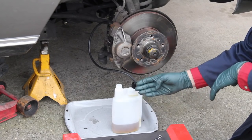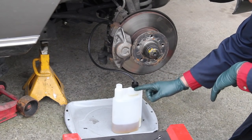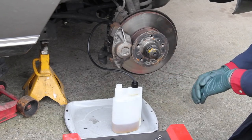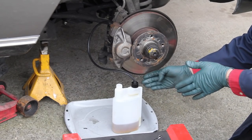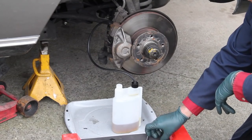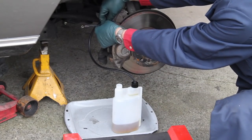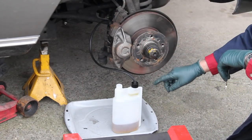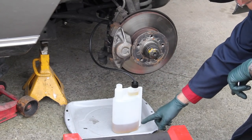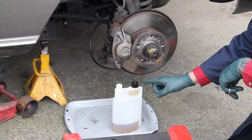Now look at this bottle. This is called my twin chamber brake fluid capture bottle. It has a very small pre-chamber right here, and out of the top of that pre-chamber you'll see this pipe tube that comes down and goes into the bottom of the bottle. This is one liter in size. I've already begun the bleeding process to save time in this video, and you can see I've got quite a bit of dirtier fluid down here in the bottle. I always remove this cap here to keep from pressurizing the capture bottle when bleeding, and I open this up about a half a turn. You can see the fluid coming in the little pre-chamber — it's already clean because the dirty fluid is already routed out and down into the bottom.